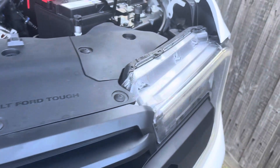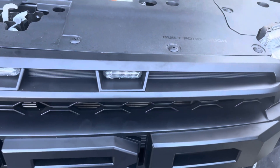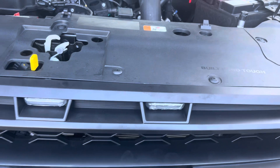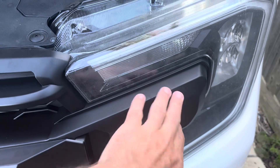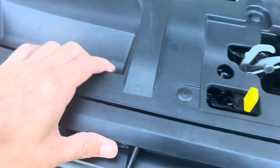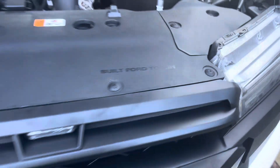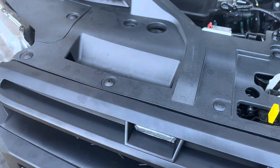I didn't film putting the grill back in, but it's pretty self-explanatory. It's literally just line up the lugs like the ones you pulled out on the original grill. The main thing is to line up the little clips here on the headlights - that's what holds it in tightest. Clip those in, line up your lugs at the bottom, then replace the shrouding on those plastic screws - it all clips back in together and holds it all in place. End result is fantastic - there it is, all done.